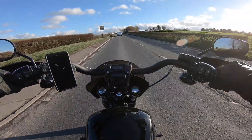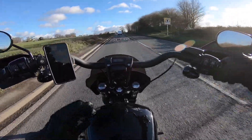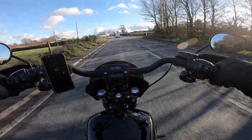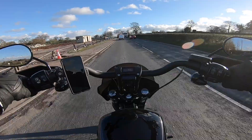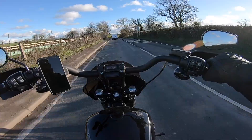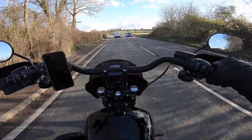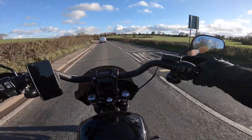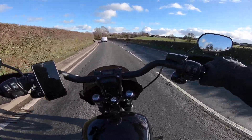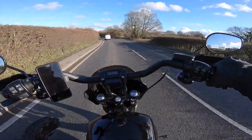As you go through your run, slowly pick up the speed and try to take corners a little bit quicker — still not crazy, not full throttle, not as hard as you would on properly run-in tires, but just progressively get faster and more aggressive over a long time. We're talking at least a hundred miles here, and for the first 20 miles you really need to be taking it super easy. Try and pick a dry day too — a nice warm dry day.